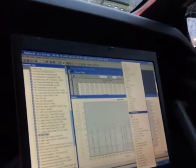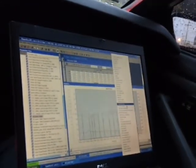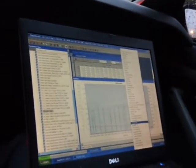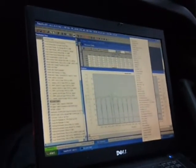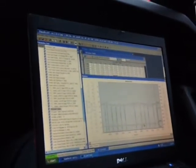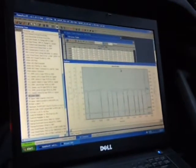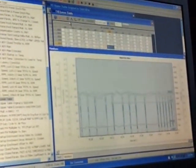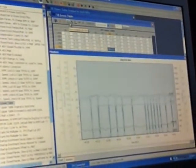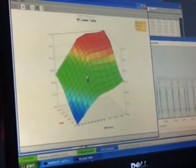I'm just trying to see the wideband reading with the commanded AFR. He's looking at the wideband reading from the O2 sensor, which gives you the air-fuel ratio. What we want to do is we want to match commanded AFR. You're using TunerPro, correct? So basically we want to match our AFR readings. And that's your VE table at the top, right? And this is a graph for your VE — volumetric efficiency.